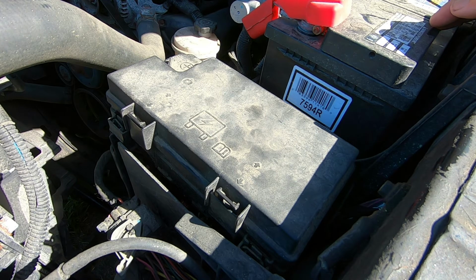They had a little kit that would add an external fuel pump relay onto the TIPM, thereby bypassing the fuel pump relay on the circuit board, but this would be hooked into the car's system, so you don't have that danger of the thing continuing to run should there be an accident. That kit cost about 90 bucks. I'm not sure if it's still available.